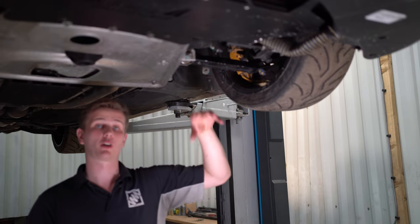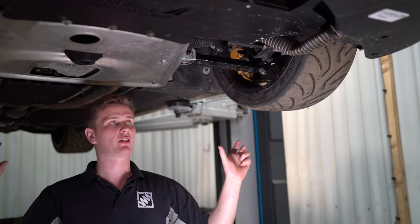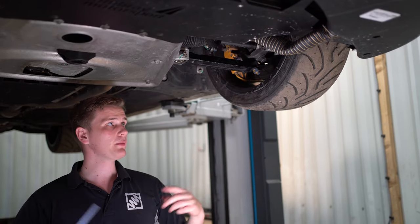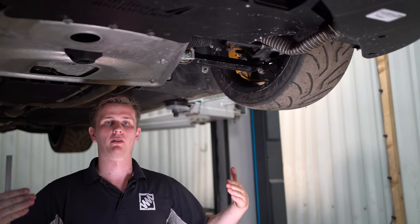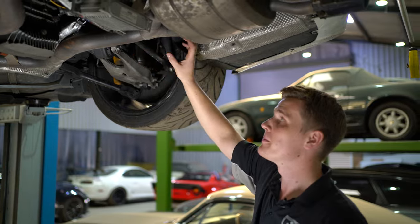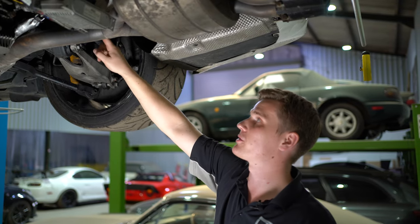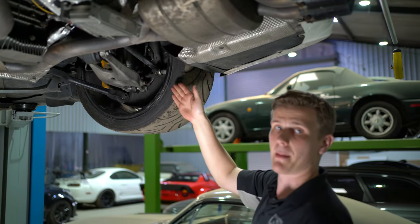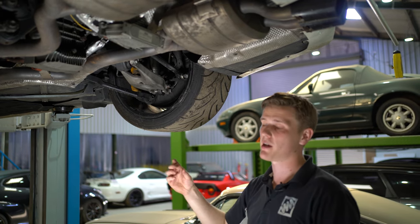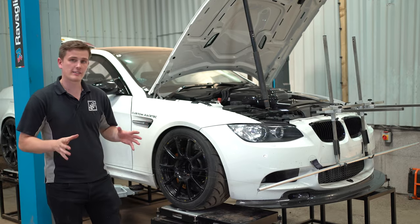We've finished the car — now lifting it in the air to show the adjustment points. On all cars there's a steering rack at the front with tie rods on the end that are threaded, so you can always adjust front toe by turning the tie rod in or out of the threaded end, making them longer or shorter to change the angle of the steering. At the rear, this car has an adjustable aftermarket rear toe arm but also retains its OEM adjuster in the subframe. On a standard car, the toe arm is the one at the rear going into the rear edge of the hub, with an eccentric bolt in the subframe — loosen and turn to give more toe in or toe out. The vast majority of cars have a rear toe adjuster and front toe on a steering rack.